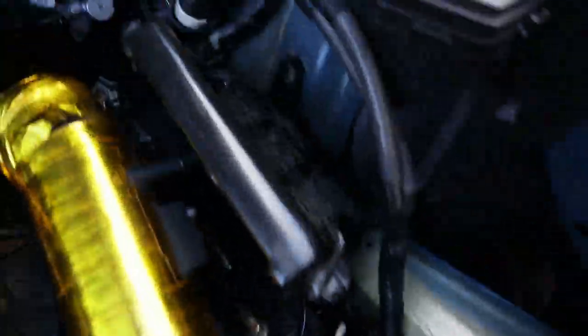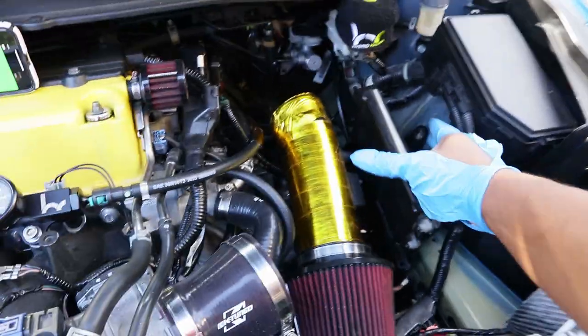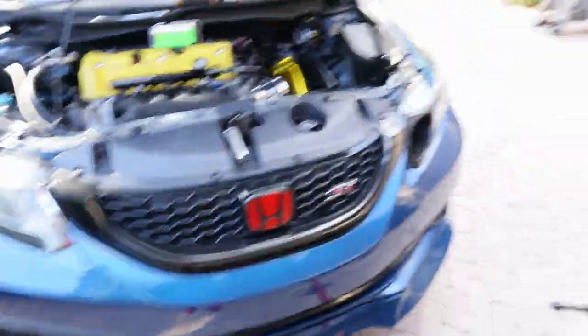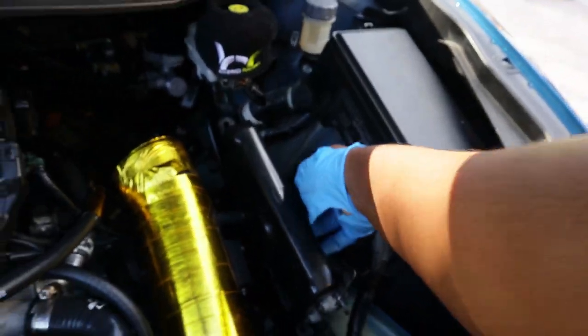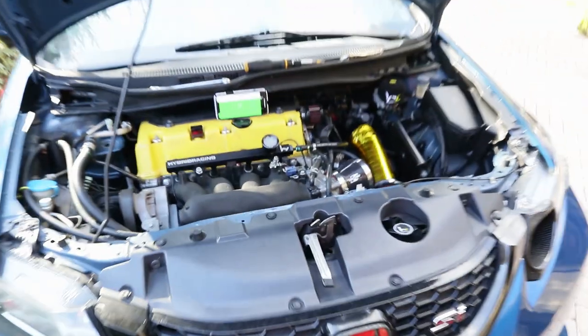So I've been playing with the mount, moving it side to side, trying to see if I could get it to sit a little bit higher before I bolt it in. Because this is a pretty big circle for you to stick your bolt in — pause. I'm trying to see the way I lined it up when I installed the transmission mount, and how that affected how the whole motor sat. That top bolt hole has so much space that you're able to slide it up a little bit more and still thread it in the bolt.